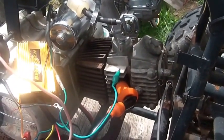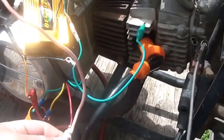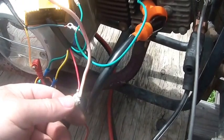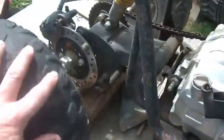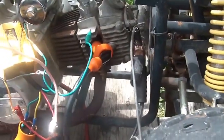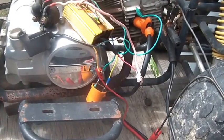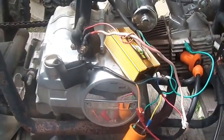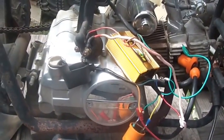I went with the minimum hookup here. As soon as you put 12 volts here, the way this is hooked up, this thing is ready to fire — you turn the engine over and it's running, which is good. The only thing that could be bad for you is if your throttle sticks or whatever. This is an automatic. As long as you've got 12 volts there, it's going to be sparking. Your throttle's stuck, so you're going to have carburation. And you've got an automatic, so you can't even pop it out of gear. You basically want to look for a soft spot to fall off the back and aim it so it ends up in the buckwheat and not out in the street.